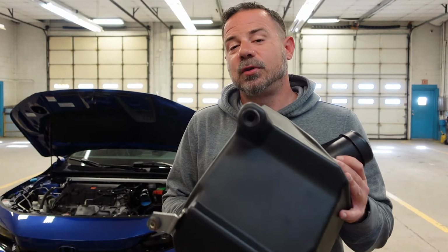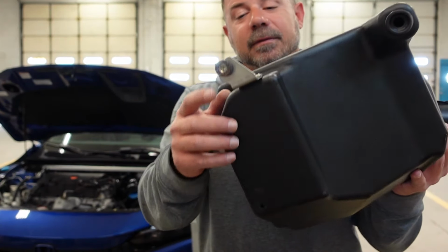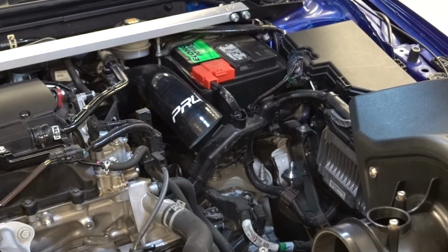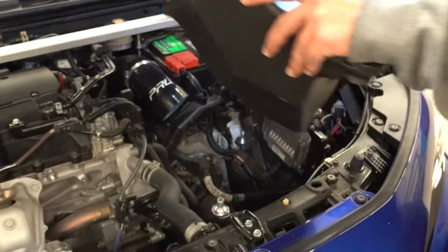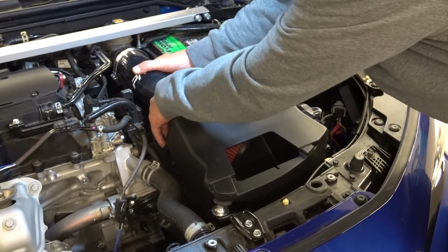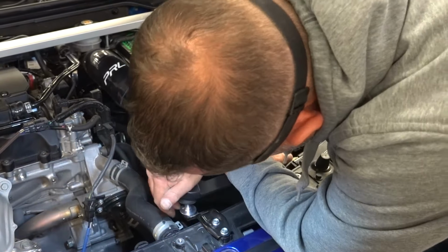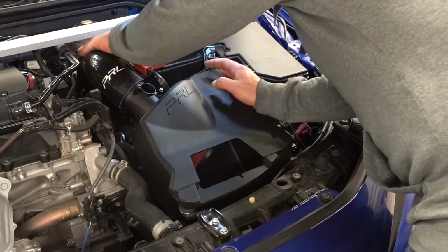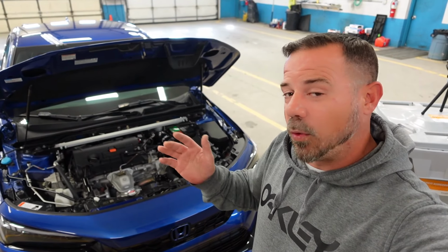It's time to put the airbox in. Those two bolt housings we put in earlier, we're gonna slide these grommets right over top of them. And then the factory screw we took out at the bottom for this one, we're gonna slide right back in. But before we can do that, we need to put the hose over top of this MAF housing. Make sure to put the clamp over top of the hose first. Everything is in, it fits great, it went much better than I expected.